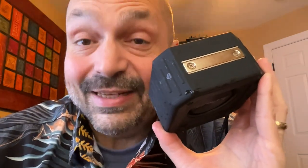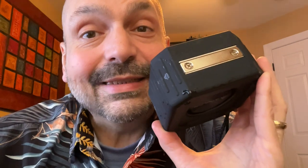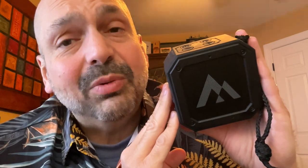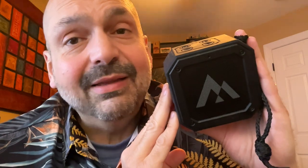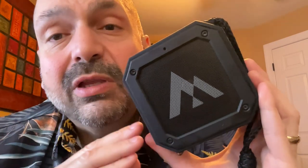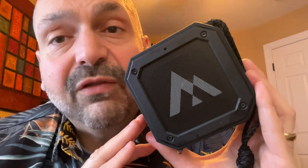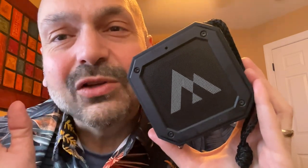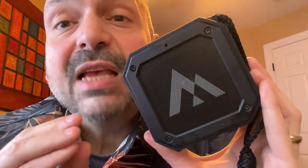You may have noticed that these speakers are a little wet. That's because the manufacturer claims IPX7 waterproof certification. Whenever a manufacturer claims IPX7 certification, I have to test it — I don't want to test it, I just don't believe them. I never believe them. Sometimes they surprise me. In this case, they didn't. IPX7 means you can submerge this speaker at a depth of three feet for up to 30 minutes, and you simply cannot do that with this speaker. I threw this in a sink full of water while it was playing, and it did last for about 15 minutes before it started to malfunction. But that's fine — just say water resistant.